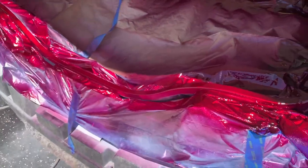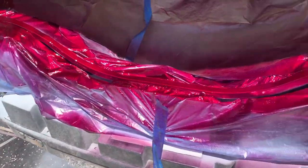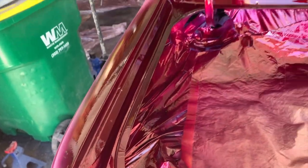And with candy, you gotta spray consistently, or you're going to get blotchy spots. I ran over with the hose right here. You can kind of barely tell. But like I said, I wasn't tripping too much because it's going to get covered up. Oh no, I got a little something here, I'll wait until it's dried up to pull that out.